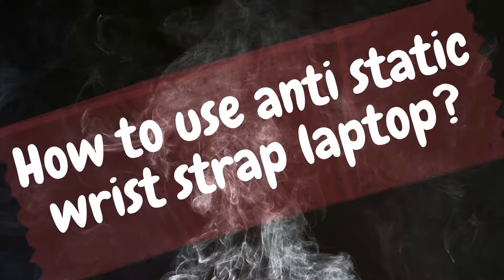What is an anti-static wrist strap, and how does it work? In video tutorials and even at your local computer store and repair facility, you may have heard or seen technicians use anti-static wristbands when building computers. The voltage differential between your body and the computer is balanced using an anti-static wristband. The excess static charge in your body will be eliminated quickly by wearing an anti-static wristband.